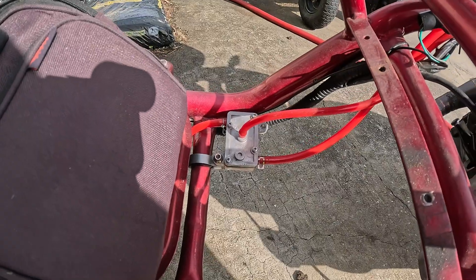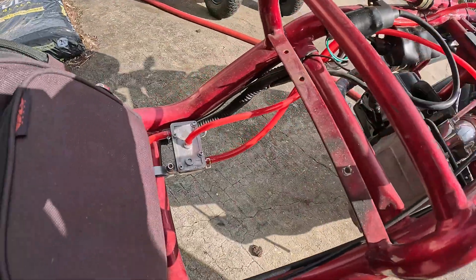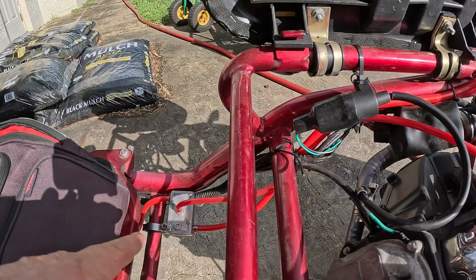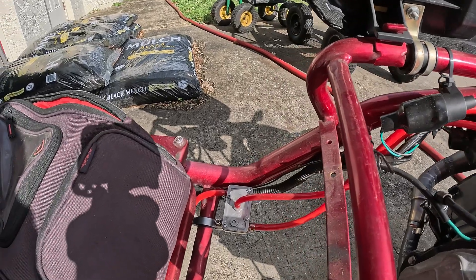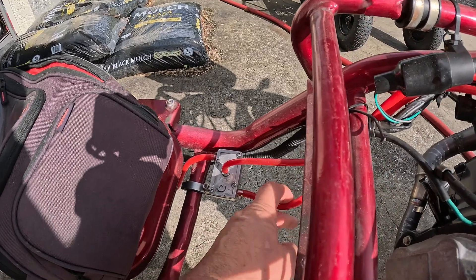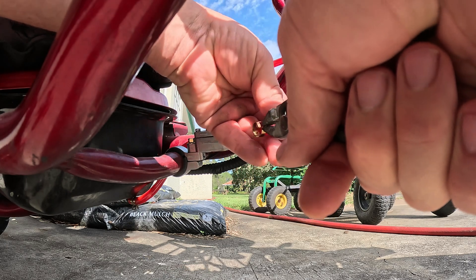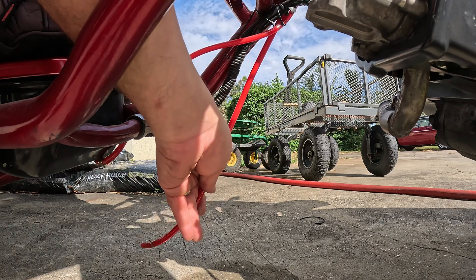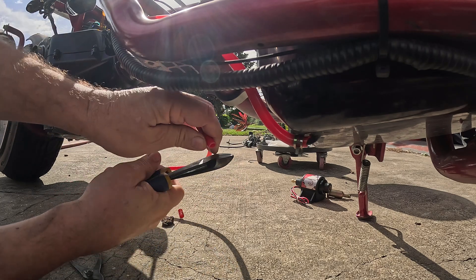It takes some stretching. Since I have this mod done differently, I'm going to take this fuel line that goes all the way to the carburetor and run it to the tank, then run the other end into the fuel pump — still not wasting any fuel line. You'll just disconnect your original fuel line from the vacuum pump and set it to the side. You won't have to worry about fuel leaking out. I'm going to get this line accessible — fuel is not going to leak out too fast; that vacuum pump won't really allow it. I've disconnected it from the carburetor and slid it down. If my fuel line is long enough, I like to cut it off where it was attached so I have a nice clean connection.